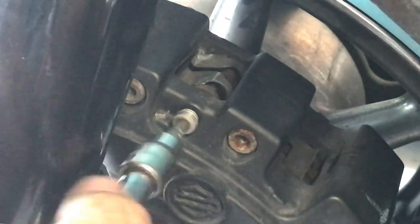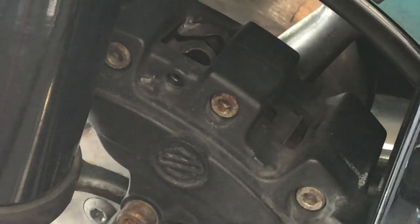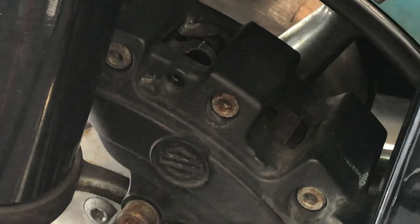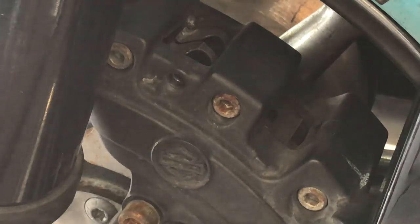Clean the pin. We pulled the pin — now to get the pads out. That's one — he's got his money's worth, that's for sure. Now let's get the back one. With this small little screwdriver, I just pushed in, and that's definitely the trick. You can see they're just so worn. Just make sure you compress them.